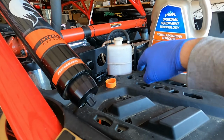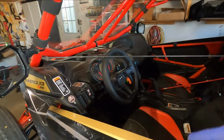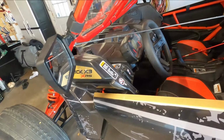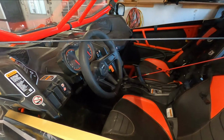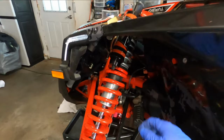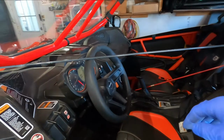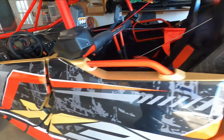So after putting coolant back in the tank, cycle the car on and off a few times. Let it warm up, let it cool off, let it warm up. Just cycle a few times. You can try to burp it by squeezing the hoses. And that should be it.